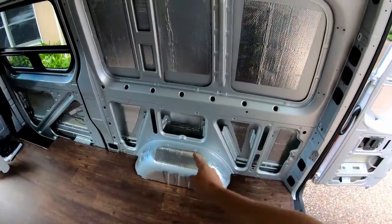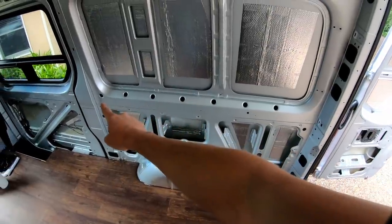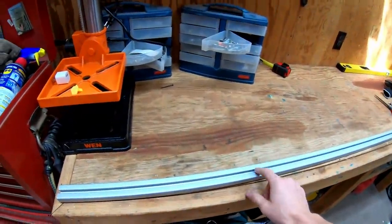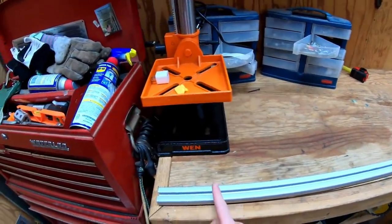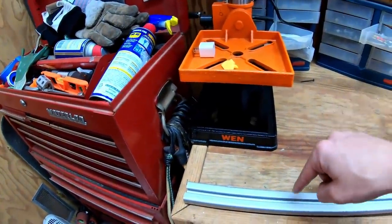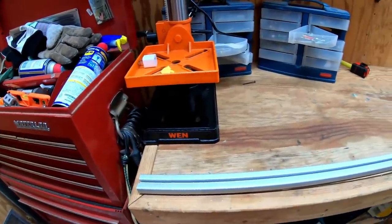The very first step is we have to install the first piece of 80-20 directly onto the van — we have to bolt it to this side of the van right here. My plan of attack for the base of the bed frame, the part that actually attaches to the steel of the van, is to drill four holes and go straight through the front of this piece of 80-20 into a plus nut that I'm going to install in the steel of the van. Mad props to whoever came up with this invention called a plus nut — this is essentially how I'm going to bolt the frame of the bed to the van itself.